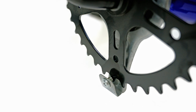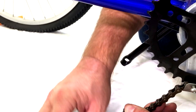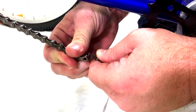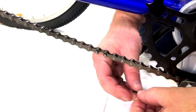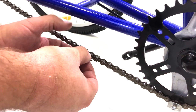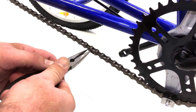Due to manufacturing or items shifting during shipping, the metal bracket for the chain guard may be in the way. You will want to remove the screw before sliding the chain through this area. Now we can attach the master link to the chain. Start with the pin by sliding it through the open hole on one end of the chain and the open hole on the other end. Now let's attach the cover, then attach the clip to lock the master pin to the chain. We found it easier to use a pair of needle nose pliers to complete this step.